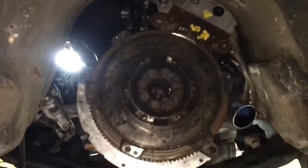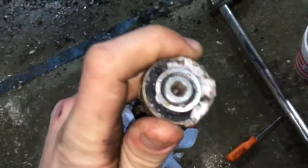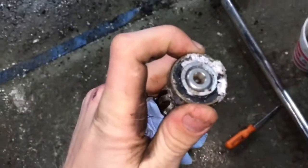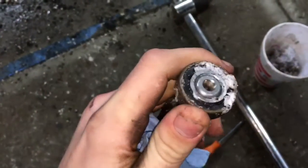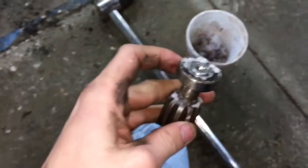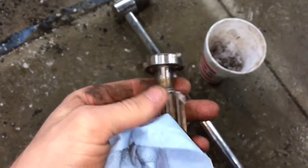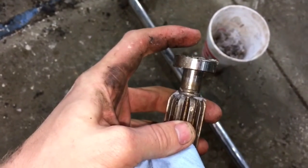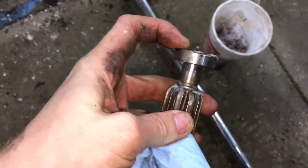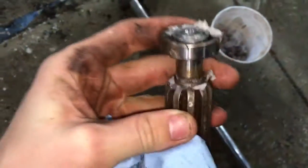The S54 is sitting in the engine bay with the old flywheel bolted to it. I just took out the old pilot bearing because it was seized. There's a video earlier in my YouTube library on how to do this - basically you wad up wet paper and shove it inside the pilot bearing, then smack it with an input shaft or clutch alignment tool. The hydraulic pressure forces the paper out against the bearing, and that's what pushed in on the seal here.